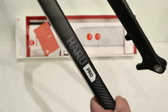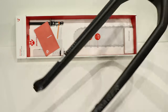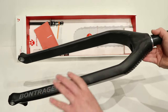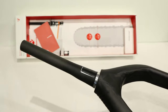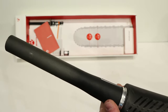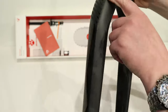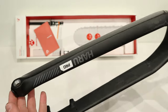This being the Haru Pro, it is a full OCLV carbon fiber fork. The forks on something like the Farley 9.6 or the Farley 5 are going to have carbon fiber blades down below and an aluminum steer. However, on this fork — also featured on the Farley 9.8 — it has a full carbon steer. It's an inch-and-an-eighth to inch-and-a-half carbon steer, with an aluminum junction for your headset race and absolutely massive hollow carbon fiber fork blades.